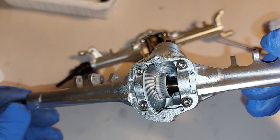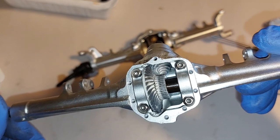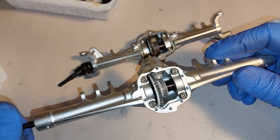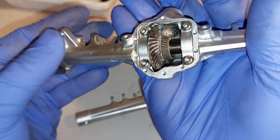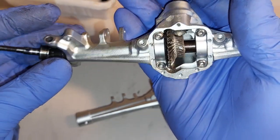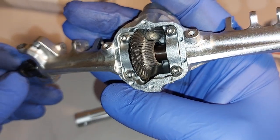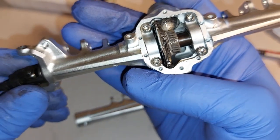The lithium grease in the rear is still relatively white, which means there's not a lot of debris — especially metal shavings from the gears — so that's always good. It's running smooth. The front looks a little bit more dirty, mainly because mud and a bit of water managed to get in there. But similar to the rear, the front looks pretty good. We're going to clean them up and look at the wear.